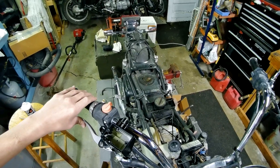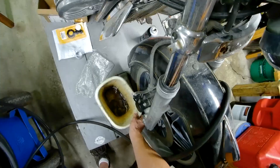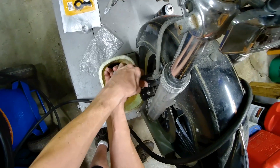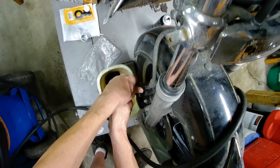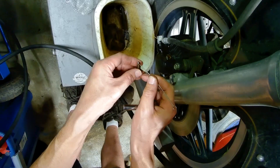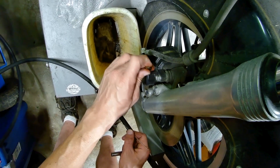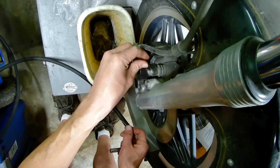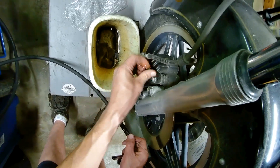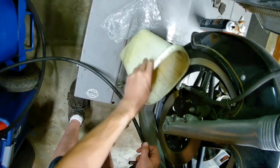Let me crack it back open. Open up this side real quick - I think this side is actually in okay shape. I think this piston is actually free; I'm not 100% sure but I think it is. Get all those bad little bubbles out. Got that one unclogged - spilled brake fluid all over, because of course it did. The bucket's right there but it still manages to go around the bucket.